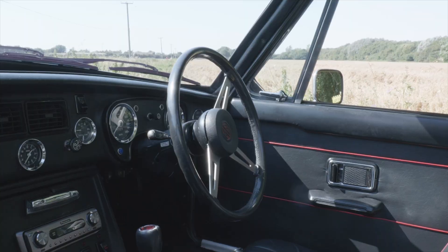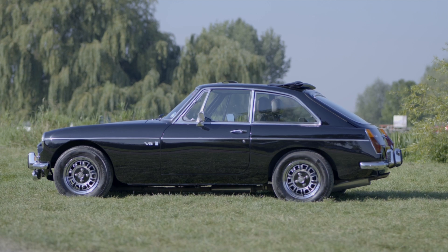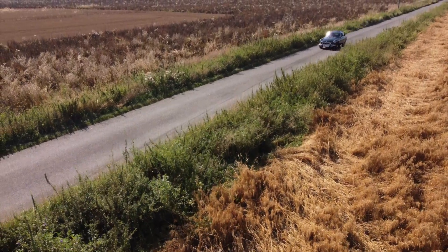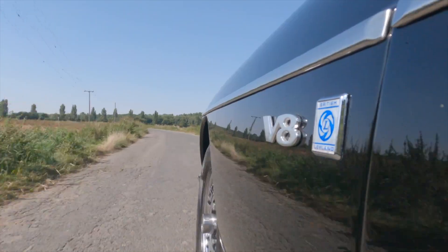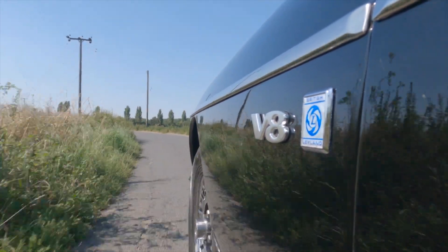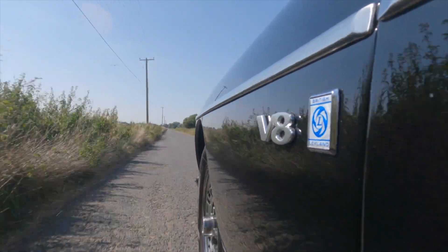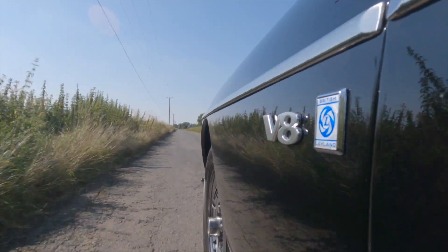One of your starting points is to check the chassis number — it should start GD1, not GHD5. As the car is based on an MGB GT, all the buying advice is very similar to an MGB or a standard GT. Corrosion, sills, floors, suspension pickup points — these are all very important in making sure there's no corrosion and they're all in good order. If it looks like a patchwork quilt underneath, walk away.